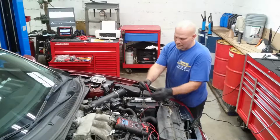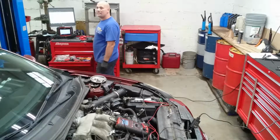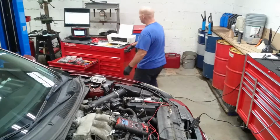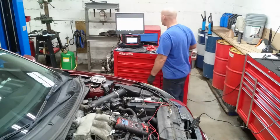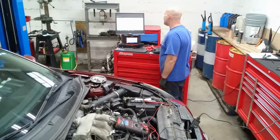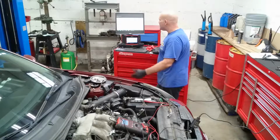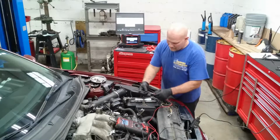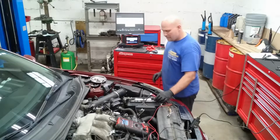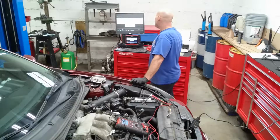You know what I'm going to do? I'm going to zero this out real quick. All you have to do is go back. That's one good thing about this scanner. I wish you could see in there. We're going to do a resistance test. It's at kiloohms or megaohms, basically the same, just add on. We want to calibrate the scope. Just connect the leads together, zeroing it out. It's the same thing you do when you first turn it on. So I'm just going through here.